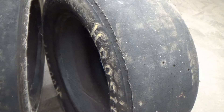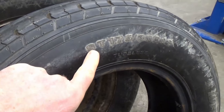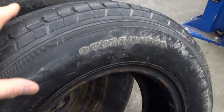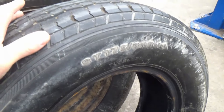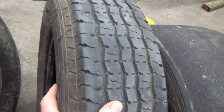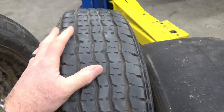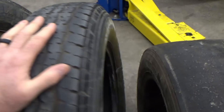This one is a trailer tire. Trailer tires are identified by ST — for Special Trailer. These are not really designed to be driven with a motor; they don't handle the same loads, but they can hold a vertical load from a trailer. The reason I have this one off is because it is fiendishly old — when the wheel fell off my trailer in the middle of Benvoulin Road in Kelowna, the towing company sheared one of my wheels getting it off the trailer, so I just bought two new tires.